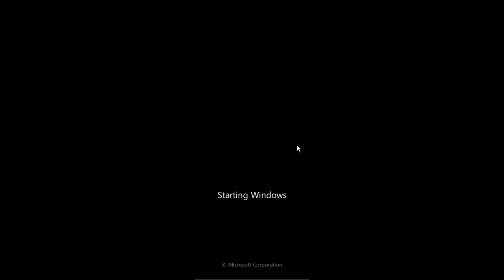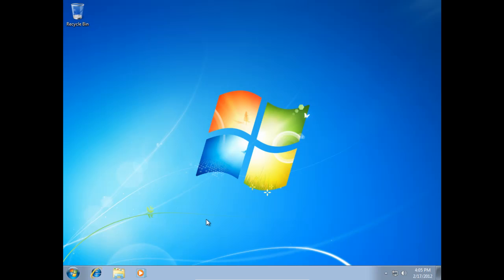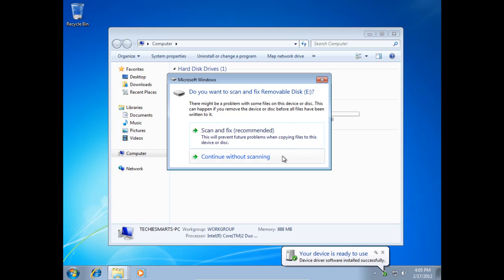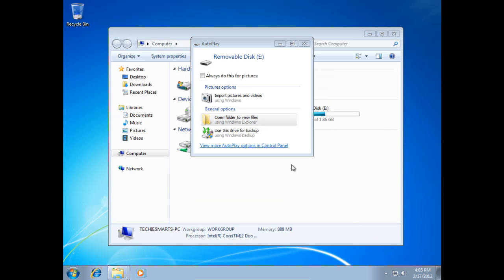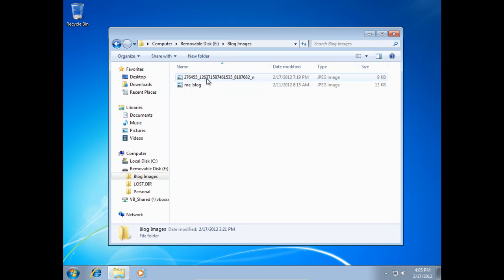Here we have Windows booting up. Once Windows boots up, simply take the flash drive or external hard drive, plug it into the computer, let Windows 7 recognize it, then go into the file explorer and make sure it's there. I ran into an issue recently where I ended up having to use the Knoppix Live CD to download drivers for the machine to get on the network so I could install them. I downloaded the drivers through Knoppix, stuck them on the Windows hard drive, booted back into Windows, and installed the drivers. So Knoppix is a very versatile tool, and most live Linux CDs are.